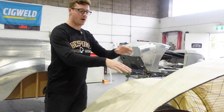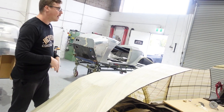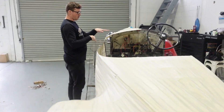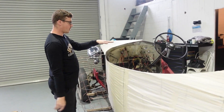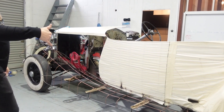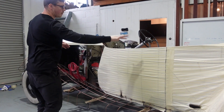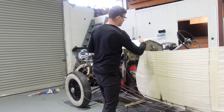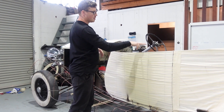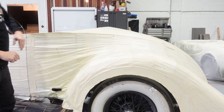I've still tried to keep quite a sharp sort of boat tail, but I've tried to lay it over further so we can really get the volume of the car down. Initially the door edge probably would have been up here, so I've dropped it a good 250 to 300mm down when looking at the side of the car. I wanted to try and give it a real look of a sweep — so the dash edge comes down in quite an accelerated radius here, and then it tapers off and actually shoots back uphill and has a continual sort of radius as it shoots around the back of the boat tail.